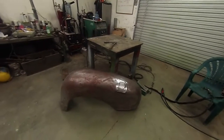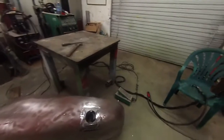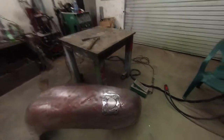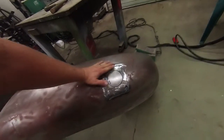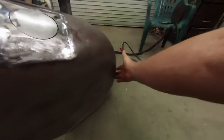This is the fender for a '54 GMC truck. Yesterday we welded in this gas door and it may not seem like all that big of a chore, but actually it was. When we first fitted it in, I measured everything out and cut the hole for the gas door. It's a prefab gas door that came from a little hot rod shop. When you get these things, they have one curve in them — where it rolls off of the top and down around. You can use these near anywhere, wherever that curve is about right.